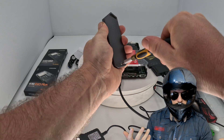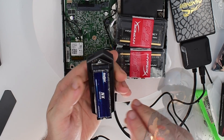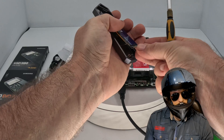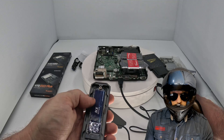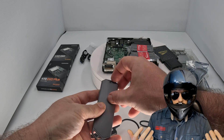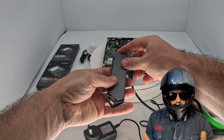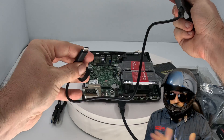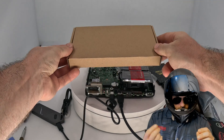Let's quickly crack open this Union Shine case and see what's cooking on the inside. There should be an M.2 M key slot, very important for the NVMe. We'll quickly mount our standoff, then fit that thermally conductive silicone if you were so inclined. We'll close this up, test it, see if we can boot — we should already have our Windows operating system as a test. We've got a USB-C cable, so we can use USB-C to USB-C, rated up to 10 gigabits per second, which is pretty fast.